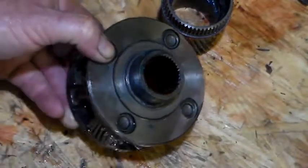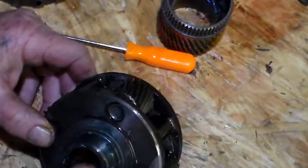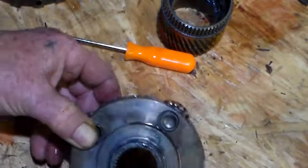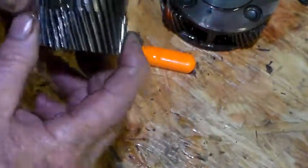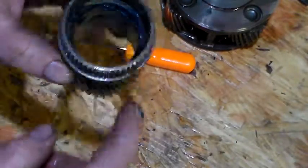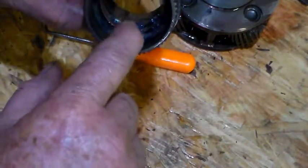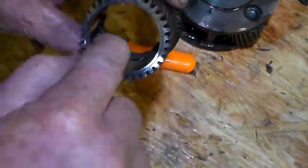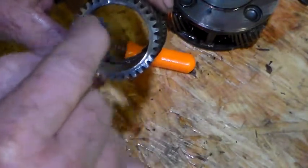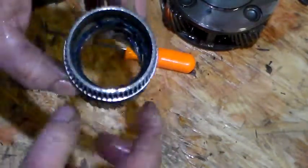Get your gears wet. Get some assembly goo and stick it in there — that's after you've inspected everything and everything's good. Then your sun gear: this is the helical side because it goes in at an angle, helical side going in at an angle, and the straight side straight up and down. Check that bushing in there. If that bushing is scored or worn out, you need to replace it. It's not hard to replace — you just knock them out with a screwdriver, get a bushing adapter or some sort of socket, and tap the new one in until it seats.